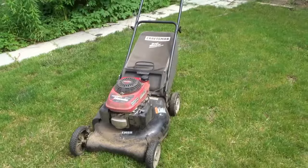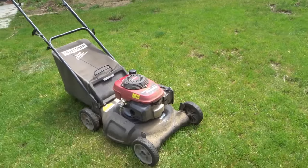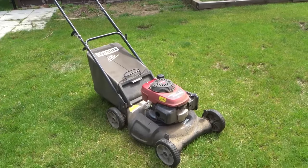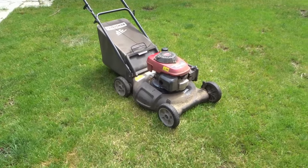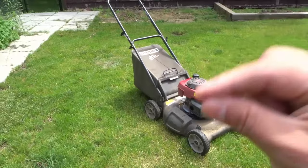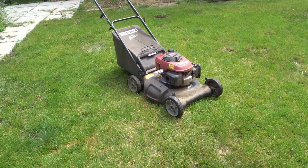You'll notice the white smoke is probably coming out from the exhaust. If that's the case, you have two options. Option one: drain the excess oil out — find the drain plug and drain it until there's just enough oil in there. Option two, which I would not recommend: just run the lawnmower and it will burn through the excess oil. If it's literally just a touch of extra oil that might work, but if you have a lot of extra oil, just drain it out because you'll be running it for a very long time.